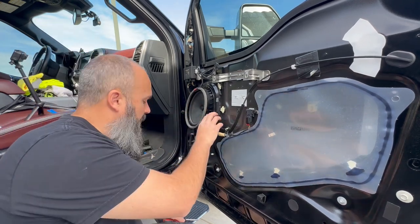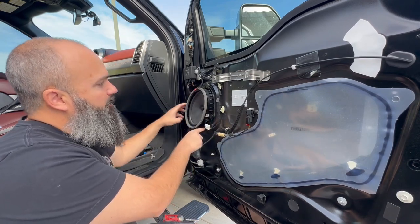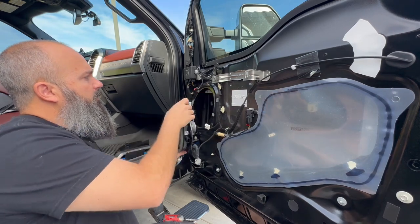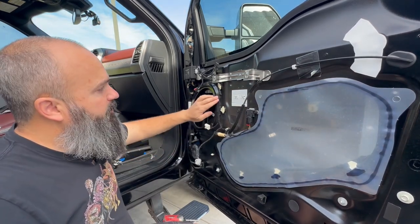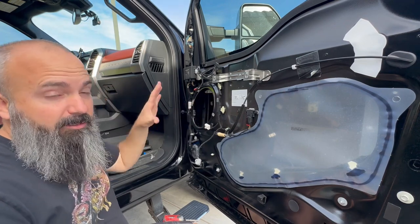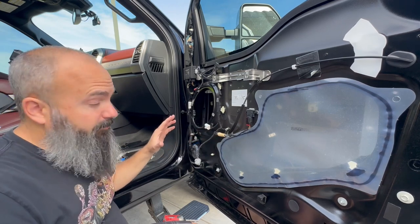The speaker might be stuck up against the door — there are little rubber isolators behind there that it screws into, to help absorb some of the vibration. I'm going to be adding some sound deadening to my door while I'm at it, so hopefully I don't get any squeaks or rattles after we get the speaker out.